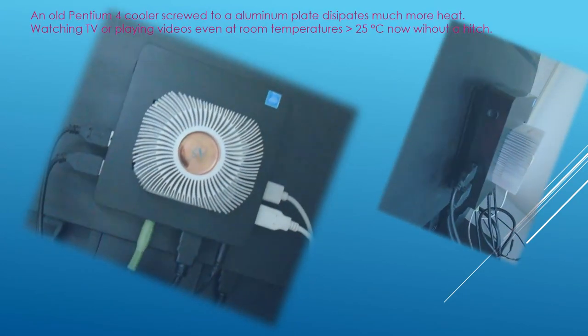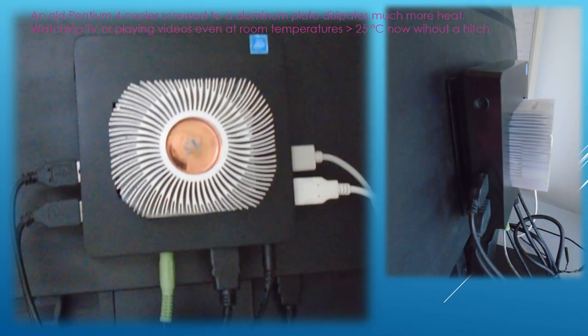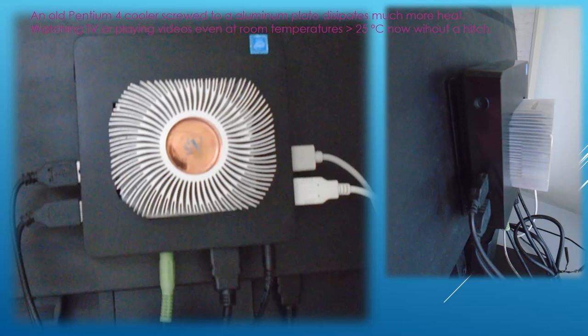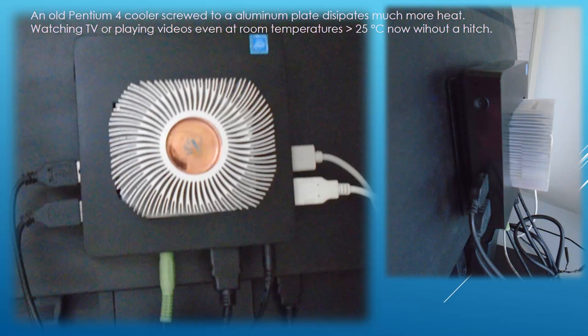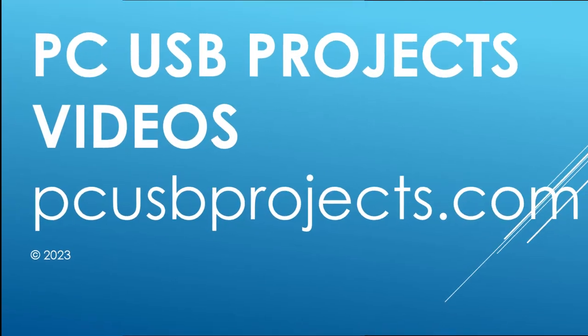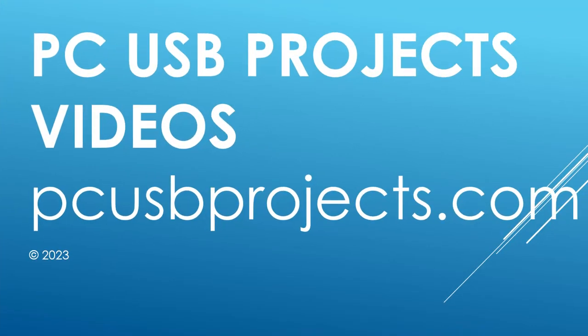Next, I had to cut an opening in the upper PC casing for the cooler to be able to protrude through. The new cooling system extension looks aesthetical and is also electrically insulated from the rest of the computer. I could have also used the original Pentium 4 ventilator on top of the added cooling rib, but there is no need for that since the cooling surface is now many times bigger and open to the open air. Thank you for watching — please like and subscribe if you liked the video.